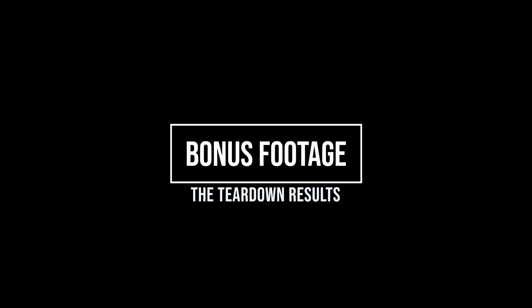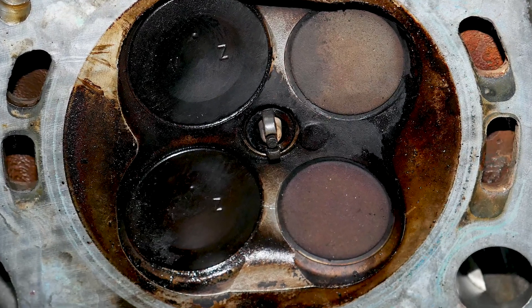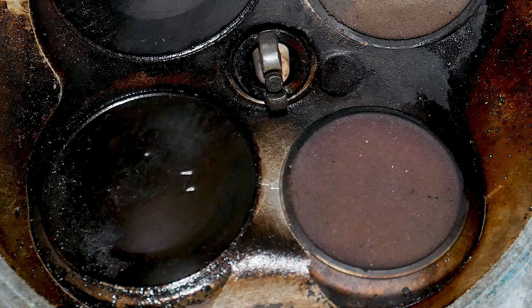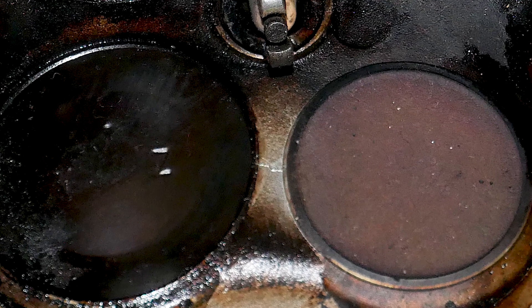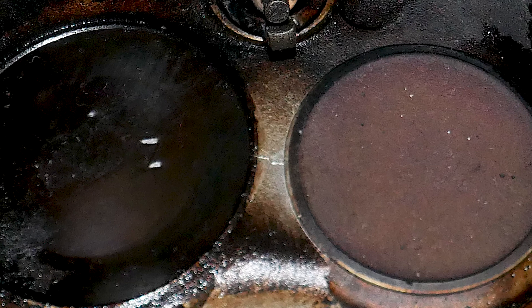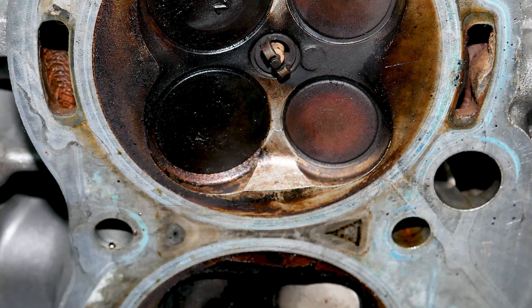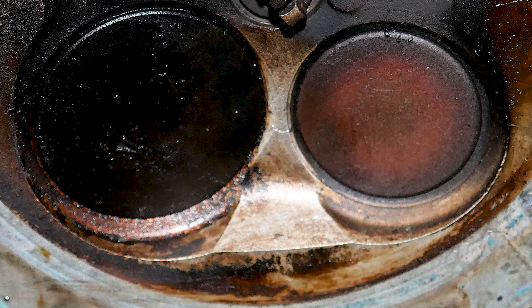Since I had a chance to tear down this vehicle this week, I wanted to share the inspection results. We knew it was going to be a bad head gasket or a cracked head, and unfortunately it ended up being a cracked head. These head gaskets were done about a year ago, but obviously this crack wasn't there — or I didn't notice it — when the head gaskets were performed. It lasted a year before it started acting up, but there is a crack. This is cylinder number four between the intake and exhaust valve. When I was inspecting all the other cylinders, cylinder number six actually had a crack as well, and it looked worse than cylinder number four. But during our testing, when we pulled out the cylinder number four spark plug, that's when our pressure stopped entering the cooling system. So unfortunately I need to replace at least one head — probably best just to do both, because we don't know how hot they actually got this thing to cause that kind of cracking. Thanks for watching and I'll see you next time.